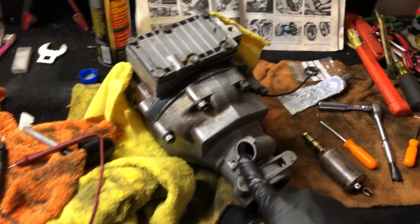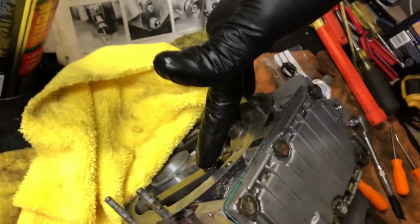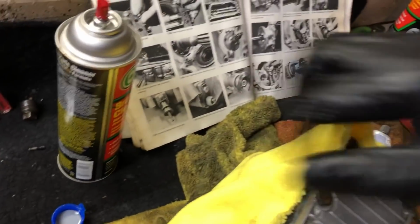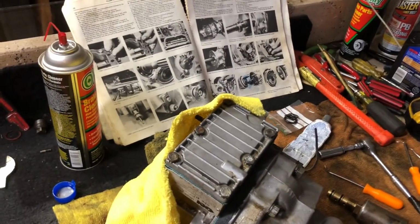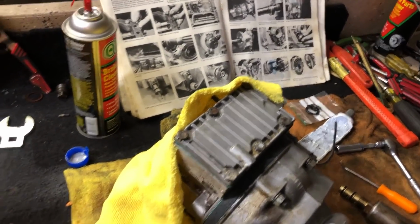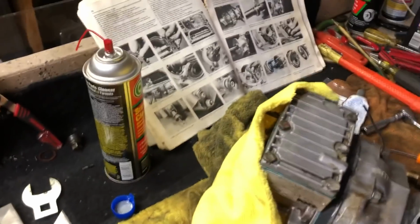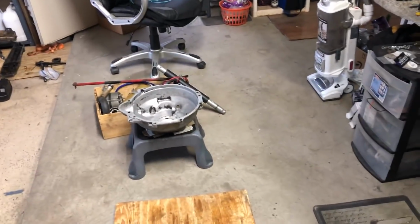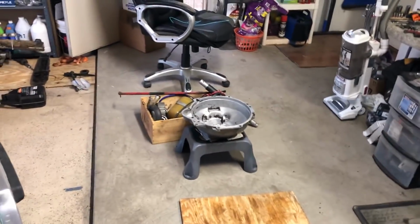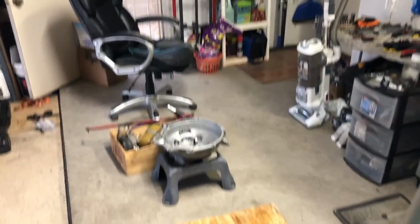And from what I was reading from the rebuild, they were saying that these two bolts here, if it starts to spin, like I had an issue with it, put a screwdriver in there to try to pry them up, but there's nothing that says it needs to be seated all the way, at least not from the Triumph Rebuild's J-Type Overdrive Rebuild page, which has been very, very useful. And then I can mate this to the gearbox, but I'd like to put the bell housing on first. There it is. Because I want to make sure that my countershaft end play is within specification per the book.